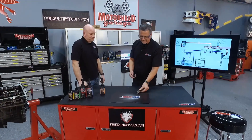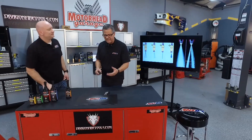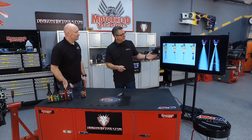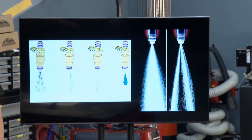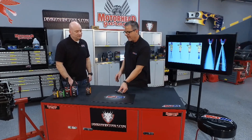Just like gasoline injection, the spray patterns are important. If that injector is sticking, you've got debris in there, you're getting heat soaking, and with a smaller pintle at higher pressure it's very susceptible to clogging. On these injector patterns, you want the one on the left — it atomizes properly and that's critical for a diesel.